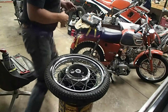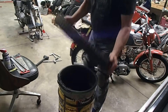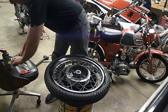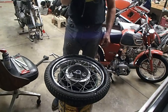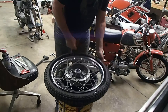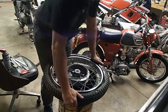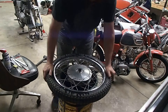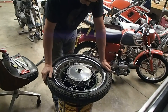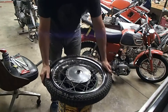I've always wanted to do one of these little tutorials. We're going to do it on a street bike tire — this is off my Honda CL125. First thing you want to do: this lubricant is your friend from Napa. Take the tire valve out of the stem to let all the air out, then you want to break the bead. Typically on a street bike tire the bead will break pretty easily.